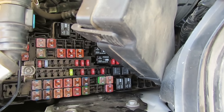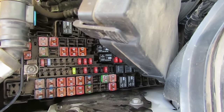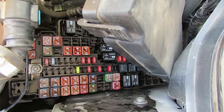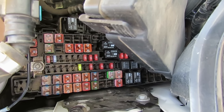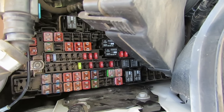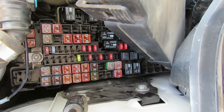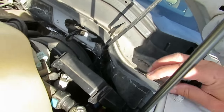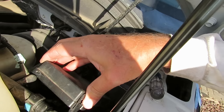I've included photographs of the fuse box and fuse assignments at the end of this video for your reference. It's certainly handy to know where this fuse box is and how to open it up, because if you're on the side of the road at night it's going to be a hell of a deal to get out. I already got several cuts trying to open this thing up, because there are other clips and ears on this that do not take the cover off — they hold the box itself on. So you only want to squeeze these two ears right here; they're the only ones that do the job.